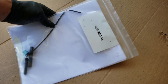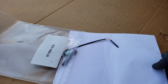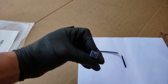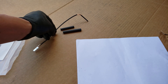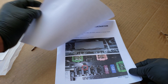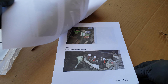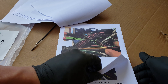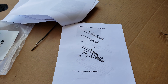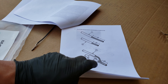This is our relocation kit and here's what's included: two pieces of heat shrink tubing, a new larger 20 amp fuse, a wire with the terminal spliced in on one end, and instructions. The instructions show how to join the wires and solder them together, then add the heat shrink tubing over the solder joint.